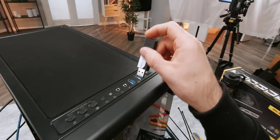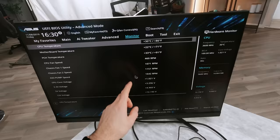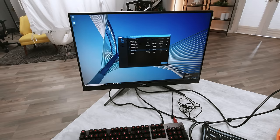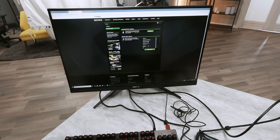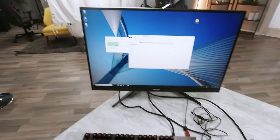That's better. Throw our Windows install USB in here. Now that everything looks correct in here, we're just going to go over to boot, use boot override to boot to our USB stick that we've preloaded with Windows 10, and press enter. Then we basically just follow the prompts. Now that Windows is all installed, we're going to get Asus's Q installer thing that shows up — we don't want any of these utilities probably — and we're going to go ahead and install the drivers. While we wait for that, we can head over to NVIDIA.com, go to the GeForce driver section, select RTX 20 series, and then we're going to select the DCH drivers. Now that all of our Asus drivers are done and we've rebooted, we can go ahead and install the NVIDIA drivers that we downloaded earlier.